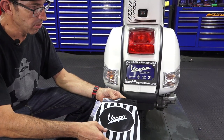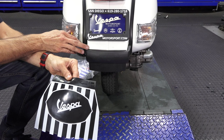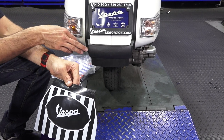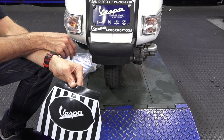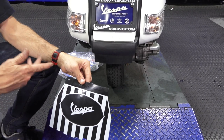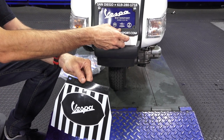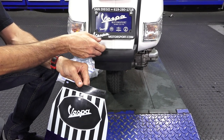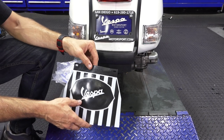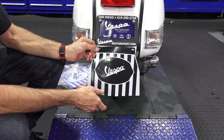So how would you mount this to the scooter? The PX is kind of an in-betweener scooter because the tail of pretty much all classic Vespas — with the exception of the PX — is steel, going metal all the way down. The P200 starting in 1977 added a plastic bumper. If you have a vintage all-steel body scooter like a Sprint or a Rally Super VBB, you'd typically have four holes for the mounted plate — either a larger European square style or American style plate — and you have four mounting points that line right up.